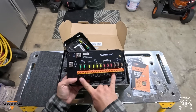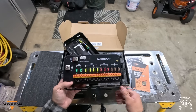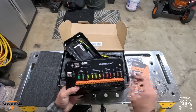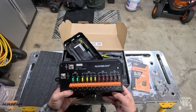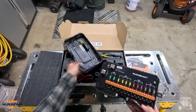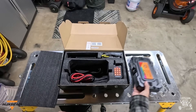You can see ports one through 12 right here — this is where you're going to put in your different connections for the unit, your actual lights and whatever accessories you want to run. Up here is where you plug in the switch panel, and this is your positive and negative that goes to the battery of your vehicle. This is for the antenna on the remote. We'll go over wiring next, but that is the switch panel assembly.